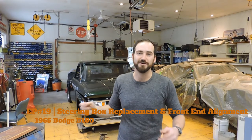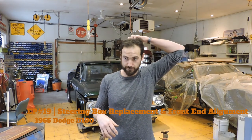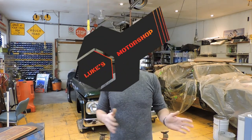All right, so I took the truck out on a test drive there. Front end was all over the place, really hard to control. So the toe is definitely way out. So I'm gonna be doing like a tape measure alignment. So basically running string lines beside the truck and setting the toe adjustment.